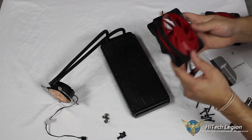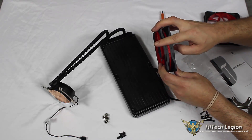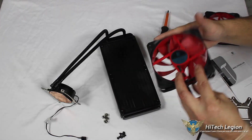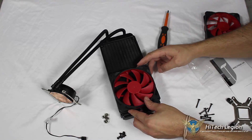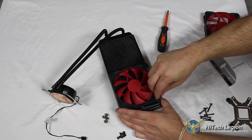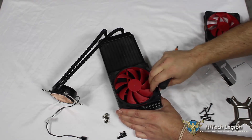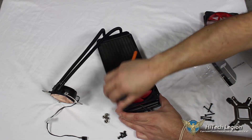We'll mount our fans to our radiator. The fans have directional arrows on the side — airflow goes from one side through to the other. If mounting this way, it pushes air through the radiator; mounted the other way, it pulls air through. Since we're mounting to the top of the case with fans inside, we'll push air through the radiator. We'll use the long included fan screws. The holes in the radiator for the fan screws are very clean, so it's easy to get started and just a little snug seats the fan on the radiator.